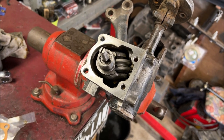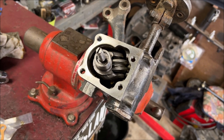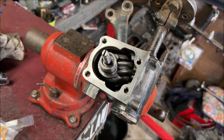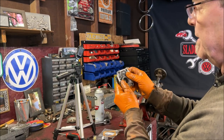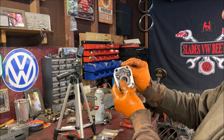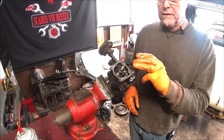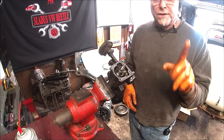This is all cleaned up inside — nice and tidy and ready for new grease. Make sure you clean this surface really, really well, because you don't want grease or oil coming out from pressure. Here's your cover; we knocked the plastic pieces out — just take a little Phillips screwdriver and knock them out. Before we put the gasket on and the cover, let's start getting some grease inside instead of having to go through the little hole.